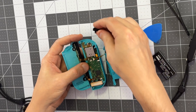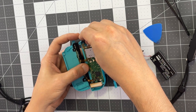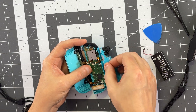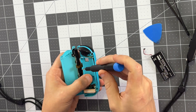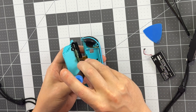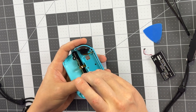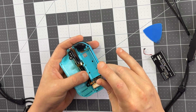If your shoulder button fell off, this is the time you can put it back on. Make sure the spring goes into the little housing and this lip goes underneath the lip over here. You know you've got it right if you can hear a click when you push. Hold it in place while you gently pull the mid-frame back over and drop it where it belongs. Now we begin the screws—remember: long, short, long, short, long. I recommend a magnetic tip because the screws go in pretty deep. Don't crank them down; you don't want to break a circuit board. Long bottom left, short bottom right, and long in the lowest right corner.